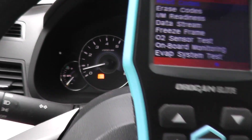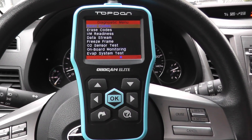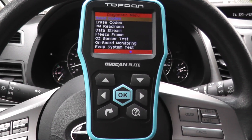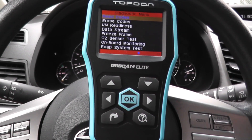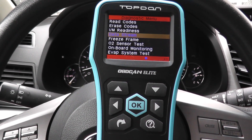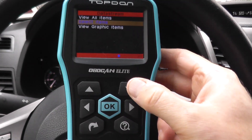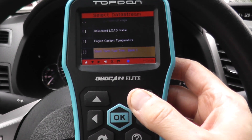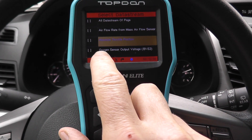The last test is obtaining live data while the vehicle is running using a scan tool's Data Stream function. You may think something like this is expensive — in fact it's not. This is a $40 scan tool; I'll have a link in the description box. Alternatively, the local auto parts store may read the data stream for you, especially if you purchase parts from them. Let's go to data stream and look for the rear oxygen sensor — that's sensor 2, or B1S2 — and let's view it as a graph.